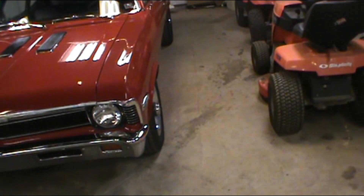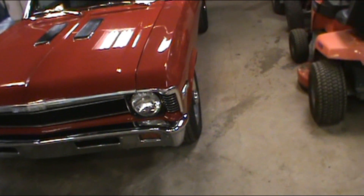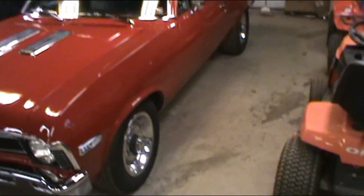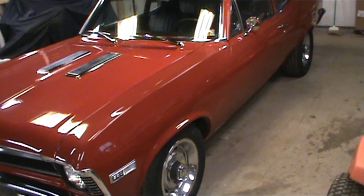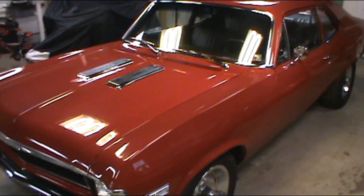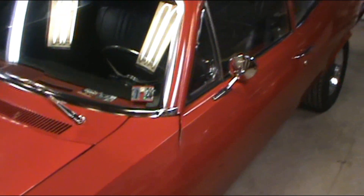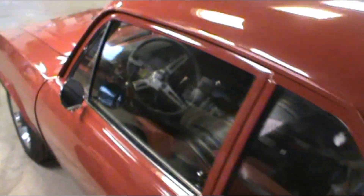So lastly, I took a look at my pinion angle, because I figured it had to be drivetrain related, and that was one thing I never really checked. There are plenty of videos on how to check your pinion angle, and I might go over it a little bit. I want to get this car back up and running by Saturday — today's Monday and I only have the evenings to work on it. I checked the pinion angle and read that you want to be below two degrees, and anything over four degrees you'll have a significant vibration. When I measured mine, I was at six and a half degrees.